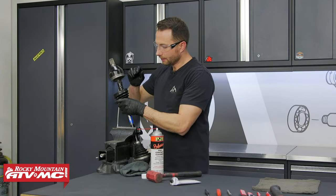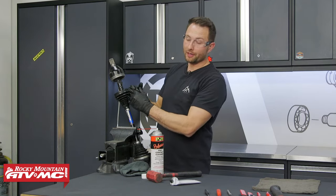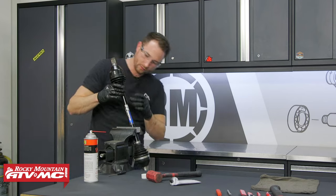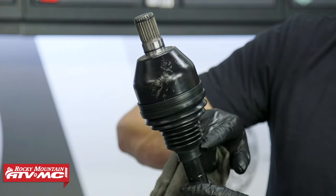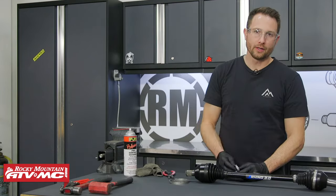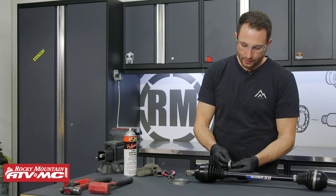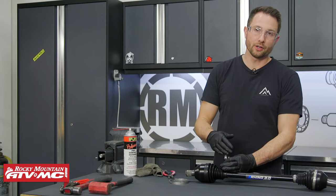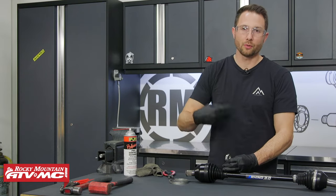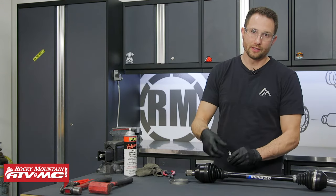Now slide the boot into place. The reason I made sure those grooves were clean is because if there's even a little grease in there, the boot can pop out of place — so you want to avoid that. In the lower section, press it up until you can feel the groove in the rubber sit on the groove in the shaft. From here we can install our bands. To install the clamps, match the other side — the open end is facing toward me. If you had both boots off and aren't sure which way, you want the open end facing the opposite direction of rotation, so it's less likely to snag on something while driving.